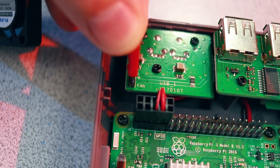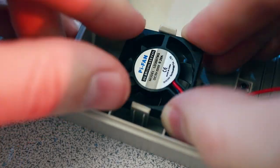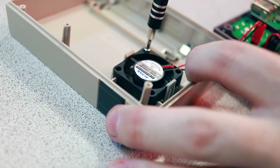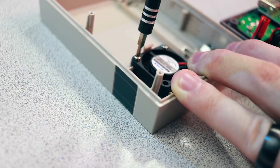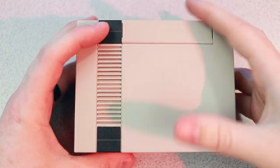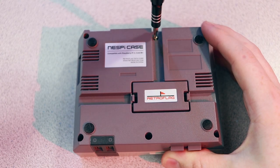Once your Pi is attached to the case, attach the fan to the conveniently labeled fan connector. Snap the fan into the upper shell with the label facing down — as a general rule, the side with the label is the direction the airflow is headed. We want it to suck in cool air from the top and exhaust it out of slots on the bottom. Tighten down the fan with some of the included screws. Note that there are four holes in the fan but only three places to screw into on the shell. Place the upper shell back on top of the lower shell and, if you're done troubleshooting, attach it with six screws through the bottom. Then all you need to do is plug in the device and power it up.